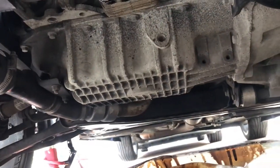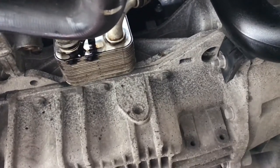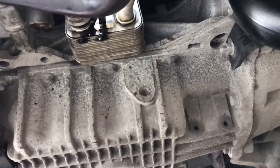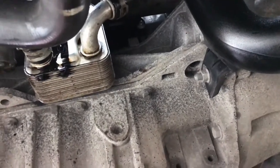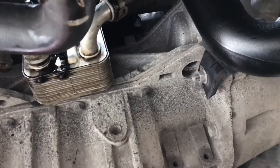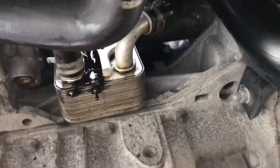Make sure there's not loads of oil here, there, and everywhere potentially ready to ignite. We've cleaned up the oil sandwich plate — it's started leaking a little bit more again — so we're giving it another clean-up, then getting the new oil filter on under there and getting the new oil in. Happy days. The next tricky bit will be getting that new filter in situ where it needs to go, because there are so many pipes and oil hoses that are awkward around there.